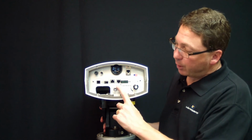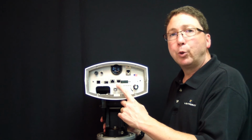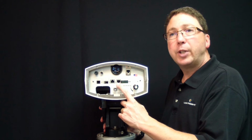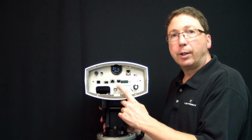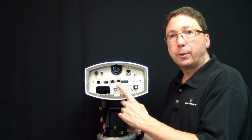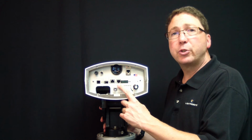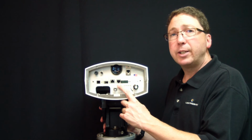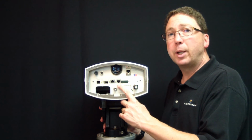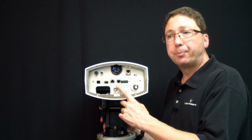In this case, standard, the system comes as a 250 megabit full duplex product. Standard is RJ45, and that would be a 10-100-1000 Ethernet port. Now, the system comes, as I said, 250 megabits standard, but you can buy license keys to bring it up to 500 megabits per second or up to 1 gigabit per second.